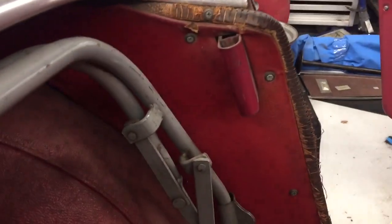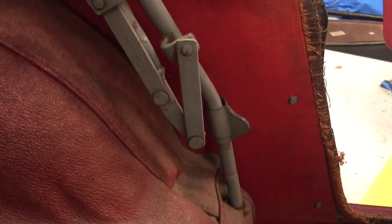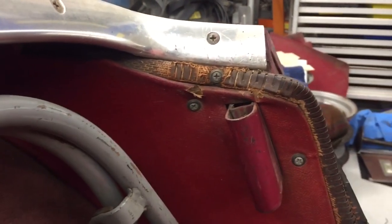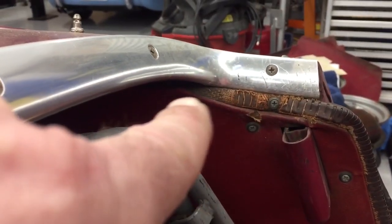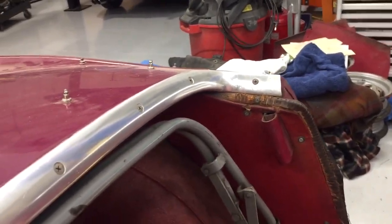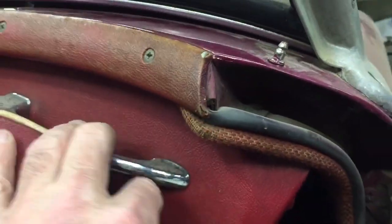Here is the original screw configuration for the panel behind the seat. You can see them going down. That's exactly the way the factory did it. And there's that termination for the weather stripping that it's now rust colored, but that beading piece, this thing right here, is the door seal going behind the panel, which is the proper way to terminate it. We've shown that in a lot of videos. Here you can see it again, the proper termination up behind here.